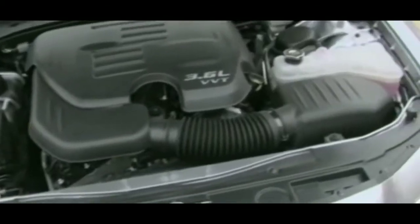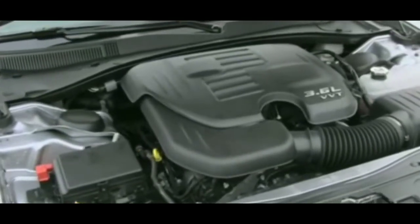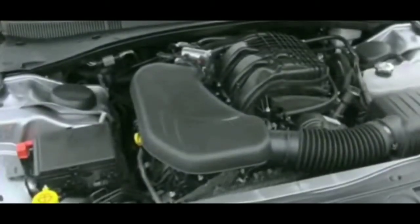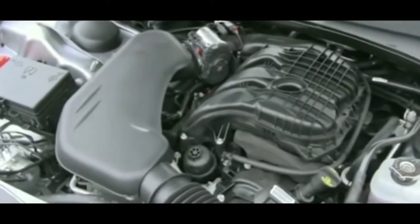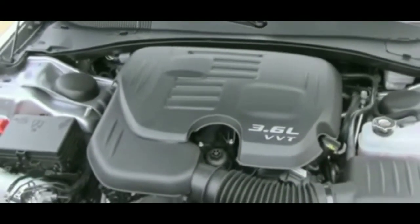If your car is not cranking and the engine is not starting, this is a very simple troubleshooting step and might be the first go-to in a no crank, no start situation. Have somebody press the brake pedal and see if the brake lights light up. If they do light up, it's not the brake switch. If they don't, it's obviously the brake switch — swap it out, and chances are good your car will start.